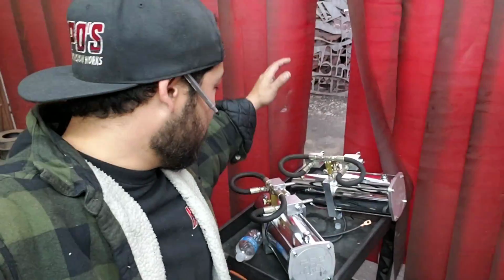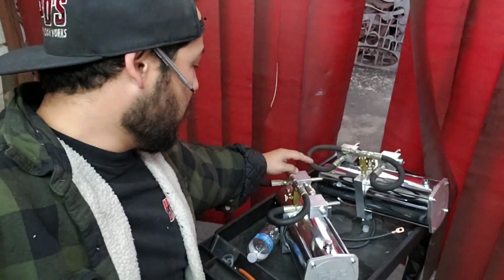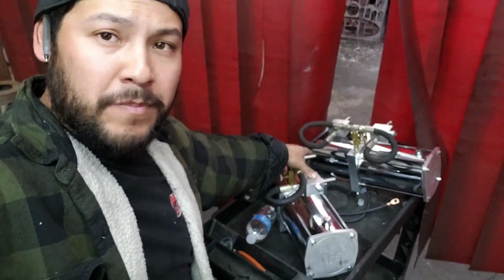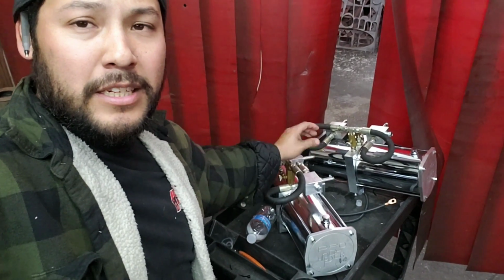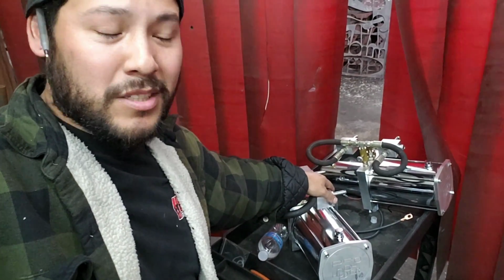All right, guys, so that is it. We got both pumps all assembled. We did end up doing 4 new check valves. Took the 4 dumps apart, rebuilt those guys up completely, cleaned them up, redid the cartridges, sealed them up a lot better than they were. Some of them were actually missing O-rings. Cleaned out all the Teflon debris that was in there.